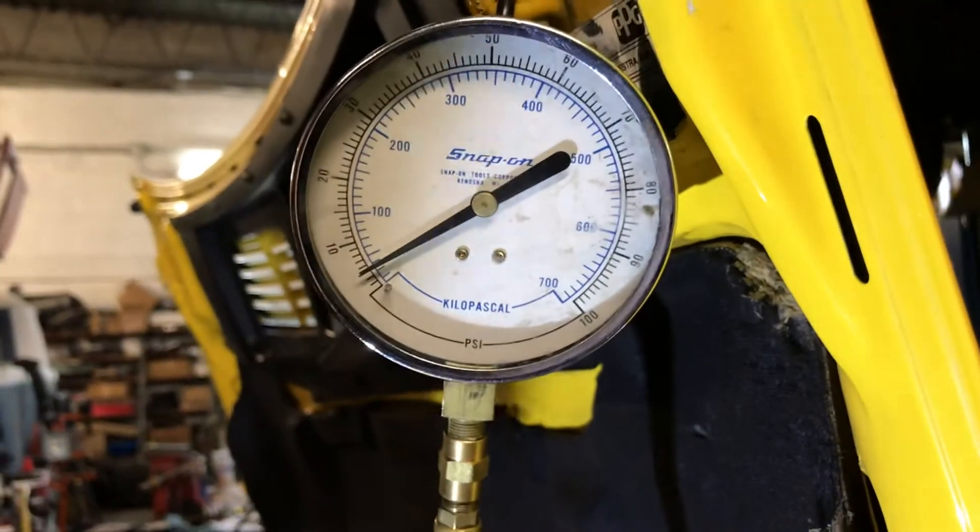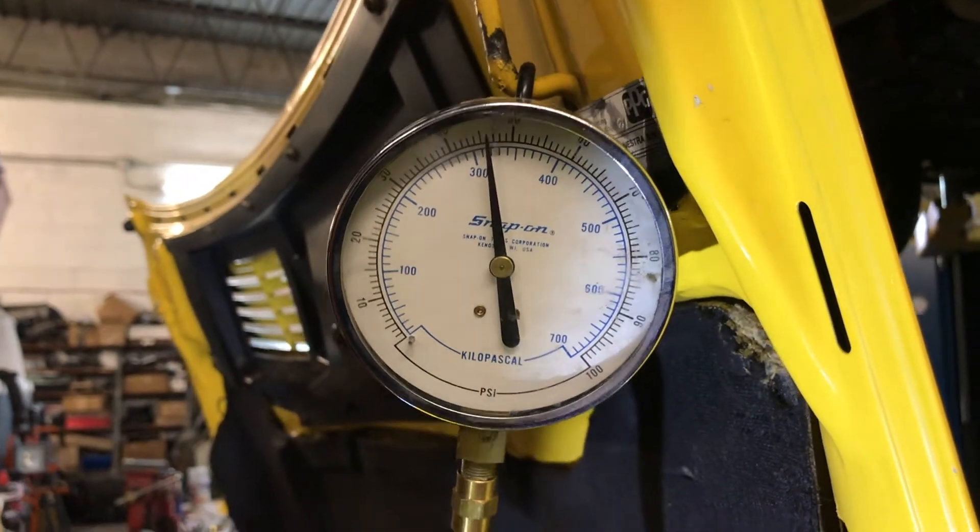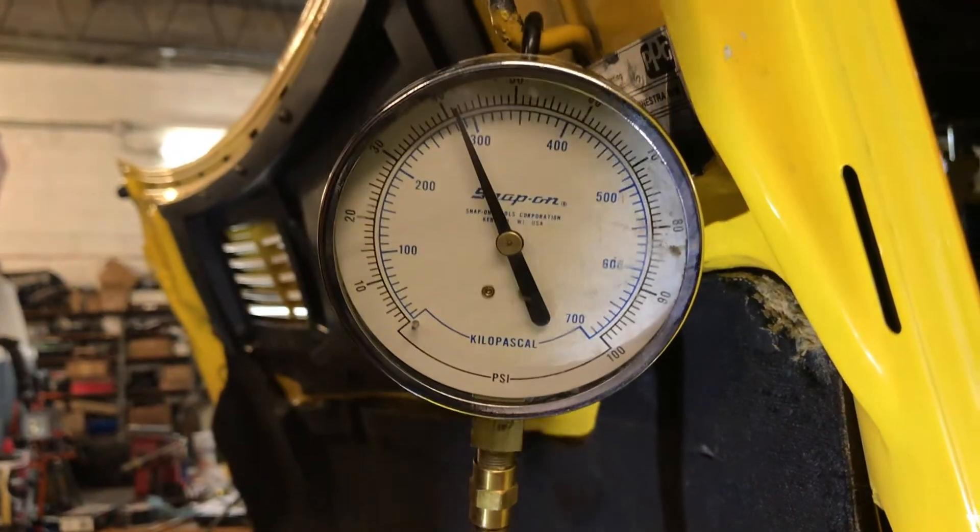Alright, here we go — we'll do this pretty quick. Fuel pump running. There's our fuel pressure at the regulator. We're cut off. And then we come right back. You can see we peaked out at over 100 PSI there. That probably just has to do with the sensitivity of my gauge and the flow rate — I don't wait for it to stabilize or back off. I'm sure if I let it bounce against the gauge the needle would come back a little bit. But that tells me we're in the good range with our fuel pump. We've also troubleshot this system a bit in advance and tested the regulator as we did in the first part of our video series, so we kind of knew we were already working with solid fuel pressure. Our next step in the next video is going to be the injection leak down test — we'll show you how to go through the process of troubleshooting your fuel injectors, and that's going to be a fun one. So stay tuned.